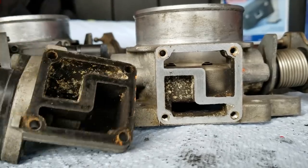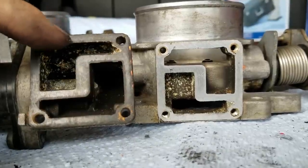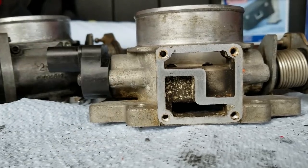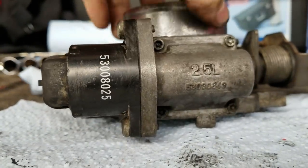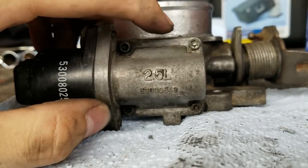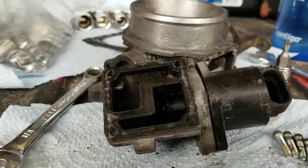The forums said we do need to remove this — it's a little bit easier than taking just the solenoid off — and notice this is very black here, that's a seal just like before. Keep in mind: don't break the seals, we need them, they're very important. So we're going to take the 2.5 liter one of these off and replace it onto the 4.0L. On my 94 YJ I have security torx, so make sure you have the correct tools for the job.